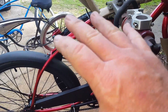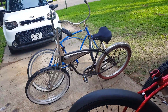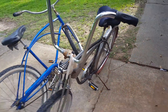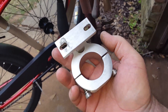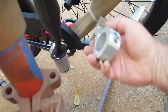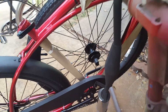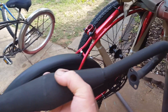I'm not saying Huffy Cranbrooks are a bad bike to build off of, but for me they're not ideal. I want to take advantage of the durability of the Murray's stronger frame. If you do go with the Huffy Cranbrook, I recommend getting a CNC motor mount designed to put the front motor mount onto the frame — it distributes the load and vibration much better, reducing the chance of cracking the frame. We've also got an expansion chamber here, though it's not an ideal one.